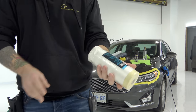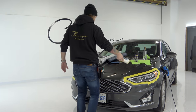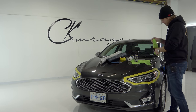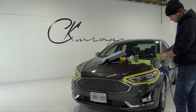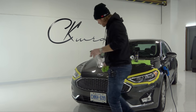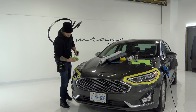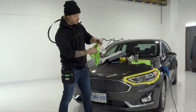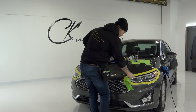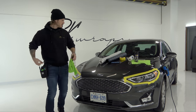The masking tool I'm using right now is really excellent — not for wraps but for covering things when you're spraying. Let's wipe the surface off and then we're going to tint it. Get it nice and clean, and do the other side as well. Let's take the cloth, wrap it around our squeegee, mist it a little bit, and just get those edges slightly cleaned up.